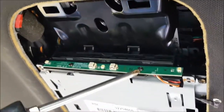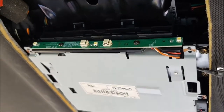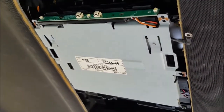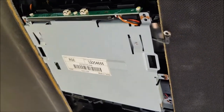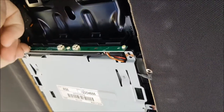Around the front of the unit there's a PCB held on with two screws, again into the plastic. It's just for the eject buttons and the power-on LEDs. Undo those two screws and pull the PCB off — it hangs by a wiring harness with a single plug, which you can unplug and remove, or just leave it dangling and it comes out with the unit.